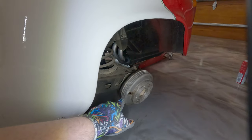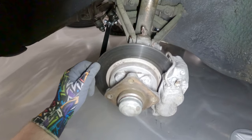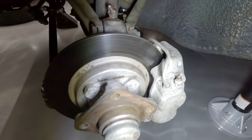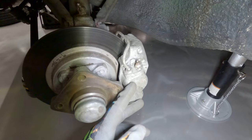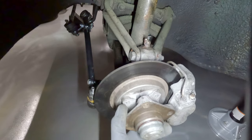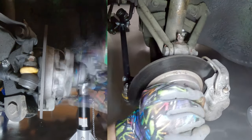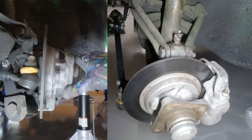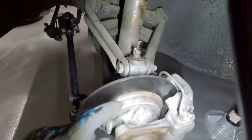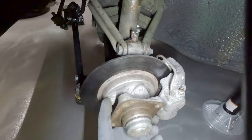These cars have a rear brake drum, and normally 600s have a front drum too. But check out these cute little discs — they've already put front disc brakes on it. This caliper is kind of interesting: it's got a single piston in the back and two pistons in the front. This rotor is seeing better days — you can see little chips out of the side, and it also seems warped because it drags when you spin it. The one on the other side is dragging too. And notice how it bolts onto the back side of the hub — pretty interesting.